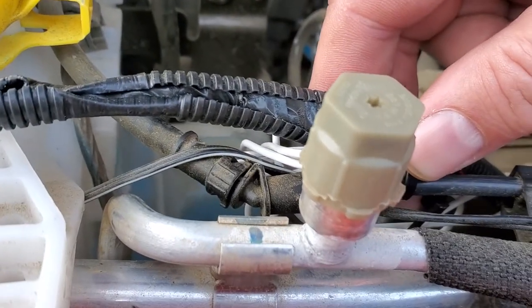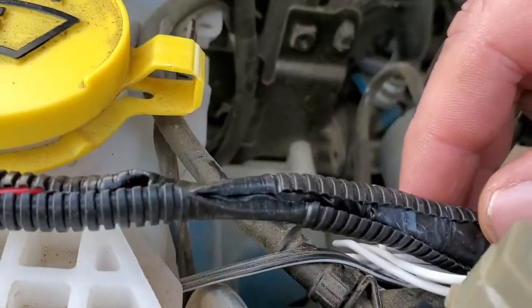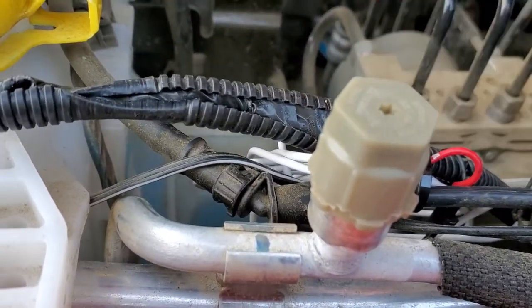The white wire that comes with the Flex Aero 4 lights has a female spade connector, so I wired the positive male connector onto the wire loom that powers the running lights. Plugged it in, soldered it with a solder melt, heat shrinked it, taped it, and stuffed it back in the loom. Zip tied it down, and voila — you have the backlights for your Flex Aero 4s.